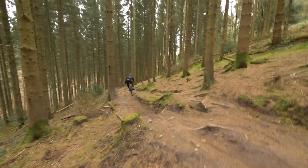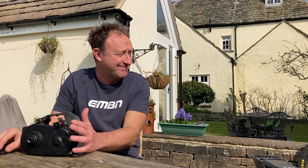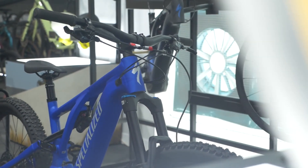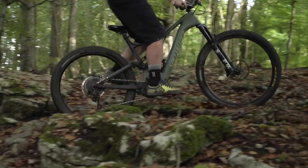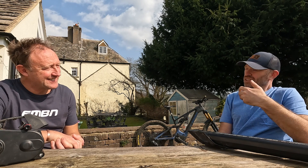This moves us nicely on to the impact of the rider in this equation. We've got 560 watts at our disposal. Now, talking about peak power - for you to get all that power, you're going to have to give something back. It's not free. You might have heard the Specialized marketing: four times you - in turbo mode. So the average rider basically pumps out about 140 watts. With your slider at 100%, you only need to give 140 watts of your own power to get the full 560 from the motor. That's a combination of 700 watts total. So if you want to get 560 from the motor, you, the rider, need to put 140 watts in, and that's irrespective of the size and weight of the rider.